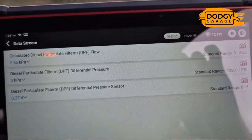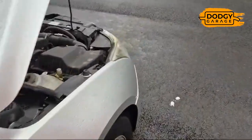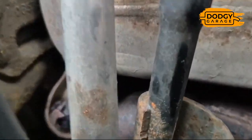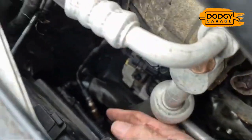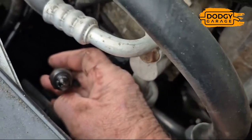I'm not going to start it now because I have the oxygen sensor open — I've taken it off. I've gone in through that oxygen sensor hole and cleaned out the DPF right next to the turbo. I did that with the engine idling. This here is the oxygen sensor I've just taken out. I'm going to give that a bit of a clean in a moment.